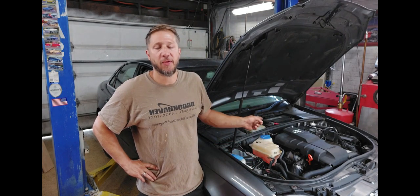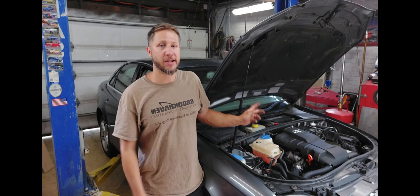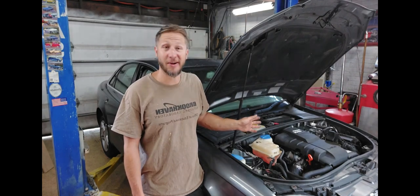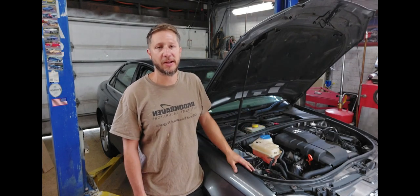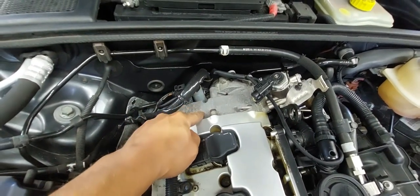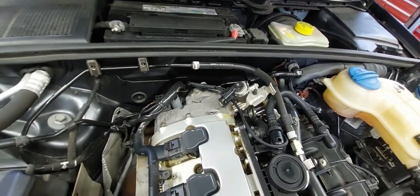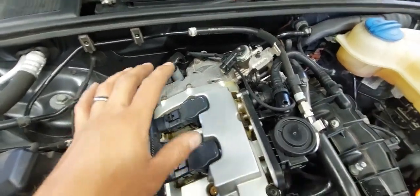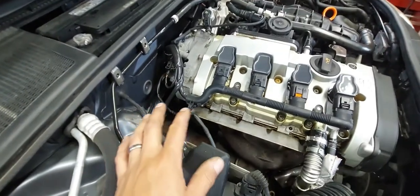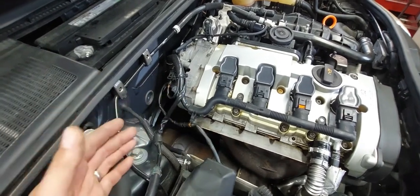So we're going to go through the steps of removing that rear cover to gain access to that chain. To even get to the cover, the high pressure fuel pump needs to come out, the vacuum pump that's back there needs to come off. It's not a terrible job, but there are a few items that are in the way, not to mention it's very close to the firewall, so it's a little tricky. Basically take off whatever you think is in your way — it's a lot easier and faster to take the time to remove something than to try to fight and work around it.